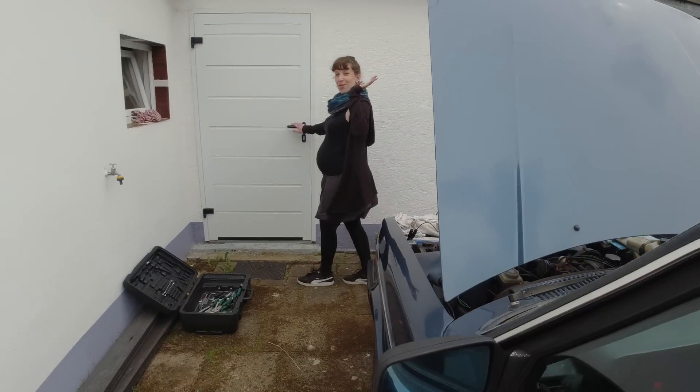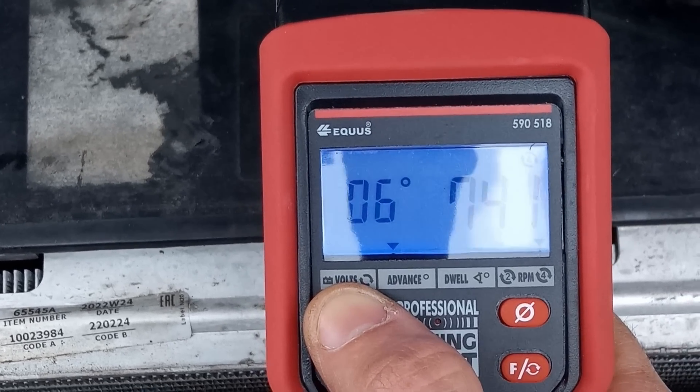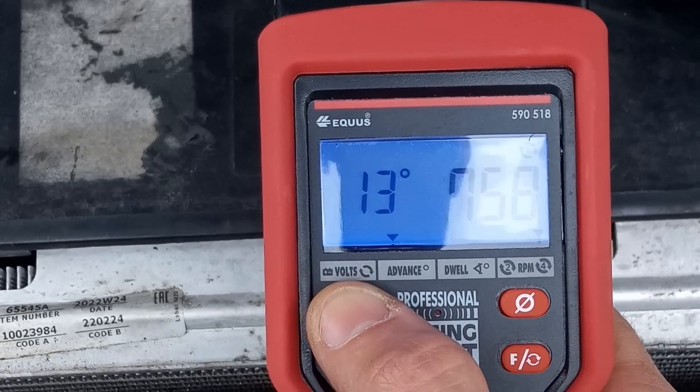Stepping away from the car for a moment - I don't know if you can hear it but they can hear it in the next town, she's got such loud piston slap it's hard to even talk over it. I have to shout. So we think we're about 12 degrees - you can actually set the tool to be at 12, then it will flash when it's at zero on the car.